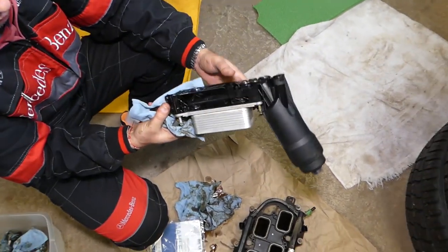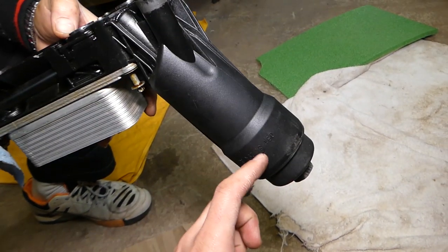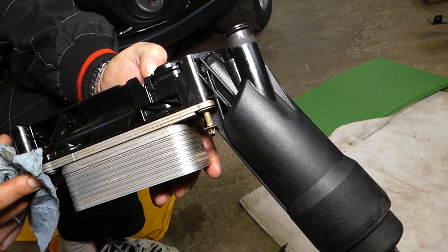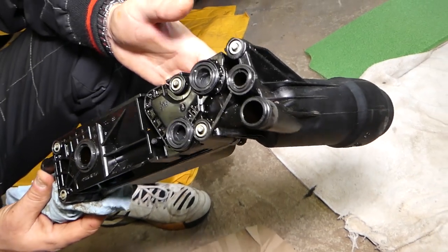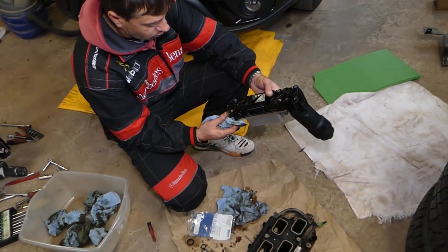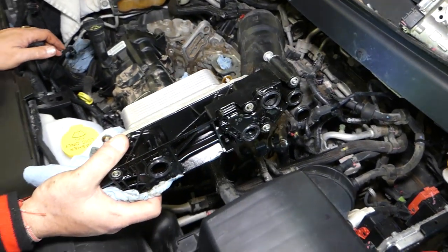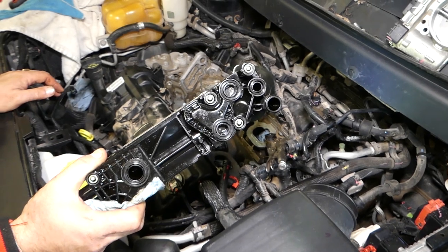This is the oil cooler - it's a really weak spot on those. They develop leaks; sometimes it's just the seals, other times it's a cracked cooler. This happens because people get the cap too tight, and as a result the housing will break and you'll start dripping oil. In our case it was just seals, so the procedure for removing and replacing is the same. All the tools and parts are listed in the description below. We'll have to do quite a bit of disassembly to get to it. First you need to drain your coolant, then we take things apart.